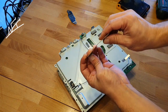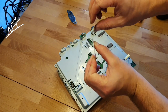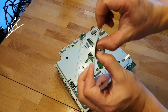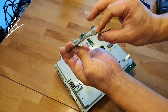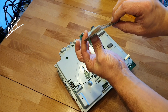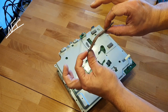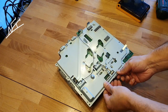When you close the PlayStation again, go over the clamps and just bend them back together again, otherwise you will lose the pressure and your PlayStation could run hot because it has no real pressure to the cooler. You can see — normally this one here was just like that, and you can see the difference. With this one here you will lose the pressure.